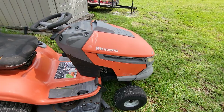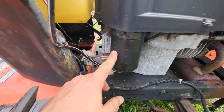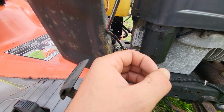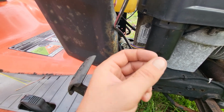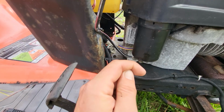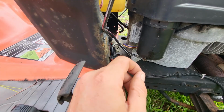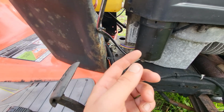Transmission works, starter works. Oh, the starter. So on this one, I was having trouble with the starter slipping. And I took it off and took it apart, and it's actually got this rubber on the starter gear. It's got like a rubber backing, and on the bottom, that bendix that pops up and spins is made of metal. When I was looking at it, it's just metal to rubber spinning. So I took a screwdriver and scarred up that metal piece, because it was polished and it's supposed to grab on that rubber part of the starter. I put some scratches in it with a flathead screwdriver and put some sandpaper on it and ran it on my bench grinder just to make it have a rougher surface. And once I did that, it engaged perfectly.